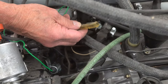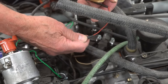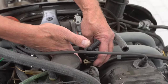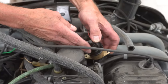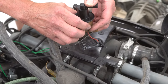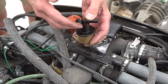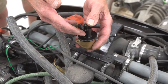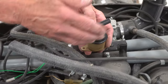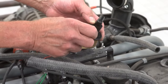The auxiliary air valve lead plugs into the red wire from the auxiliary air valve, and this is powered when the car is running, not just when the key is on. Since it has air coming from the plenum into the air cleaner, it often gets the blow-by and condensation from the cold engine. What's inside is like a revolving door — the condensation keeps going in over the years, rusts the door shut, and then you either have a situation where the door is closed or open. If it's open, it's fine when cold but idles too high when it heats up. If it's closed, it's hell trying to get the car to run when cold. Check this periodically and spray a little WD-40 in there to keep the door lubricated.